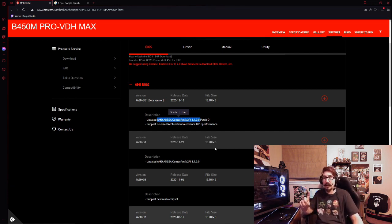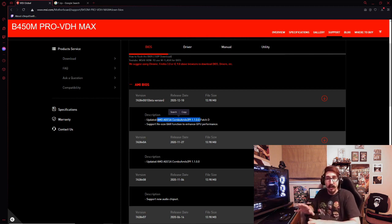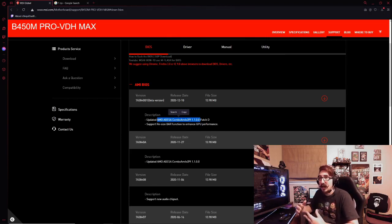There is one other difference with ASUS at the time of this video. ASUS has a version — the AMD AGESA Combo AM4V2PI 1.1.8.0 — that is not stable. That's only with ASUS. A few months down the line as more BIOS updates become stable and get more features, that will change. But until then, if you're getting an ASUS motherboard, don't get that one — get the 1.1.0.0 for right now until you know it's stable.